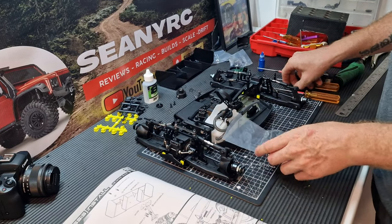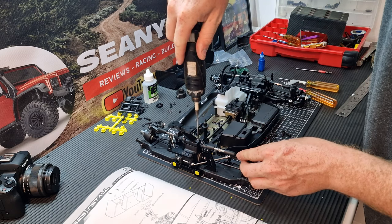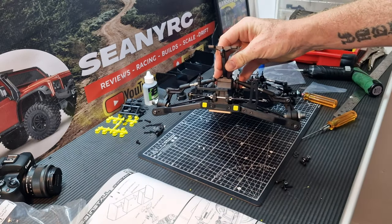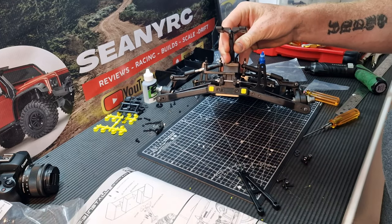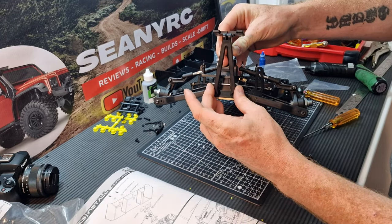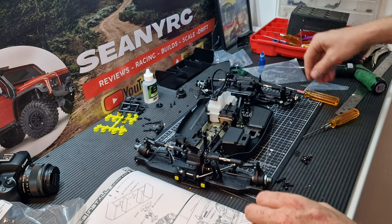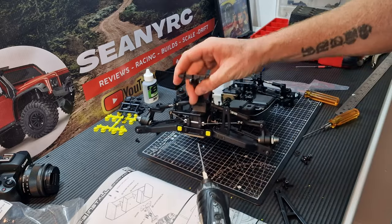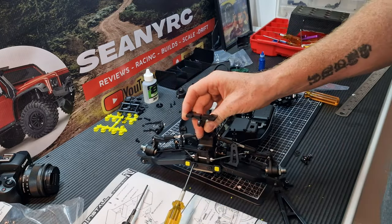And there's that awesome wing mount. Something that literally just stands out in pictures on the track. It does really, really look good. The stiffener comes standard with the kit, so definitely make sure you fit that. Although they are going to be making a change to the mount where the wing sits, and that stiffener shouldn't be required, but for now, put it on.